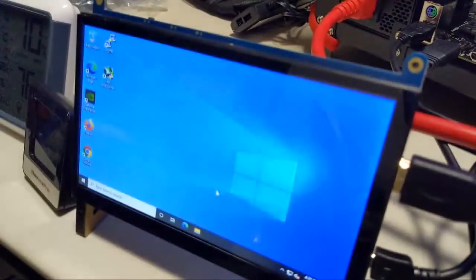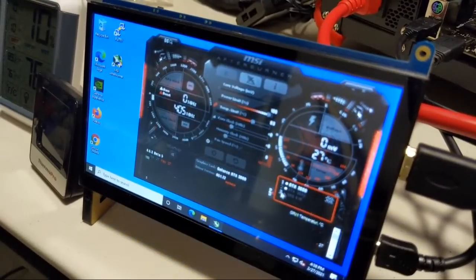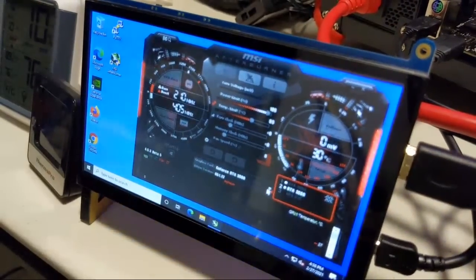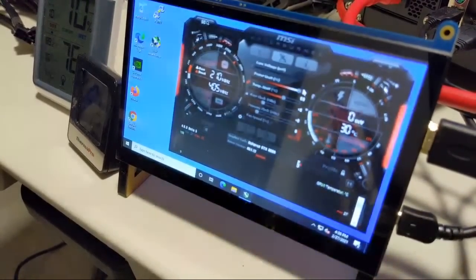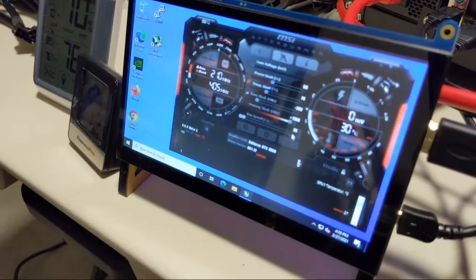Let's open up MSI Afterburner, let's put in the overclocks, and let's select the GPU. Yeah, it shows up, perfect. Now, my saved profile did not save, so that sucks. What were our overclock settings again? 60 power limit, minus 200, and 1300, right? Let's do 60% fan because we know that these cards are really cool already. There we go.